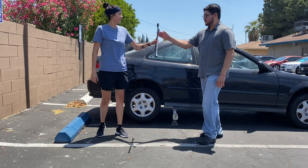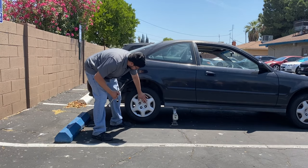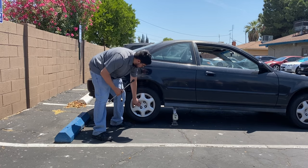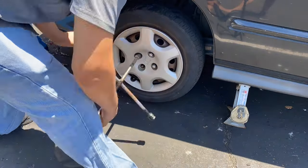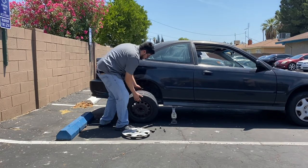I got this crossbar right here. When we take off the tire, you never want to start on the top bolt because the tire will fall off and will probably crush your feet. So always start on the bottom, then the left and the right, and then the top.